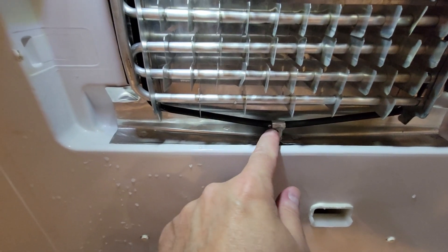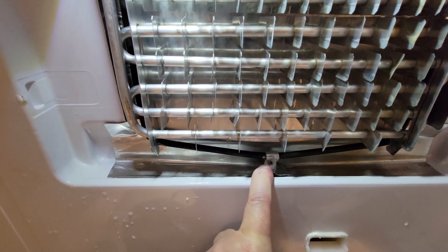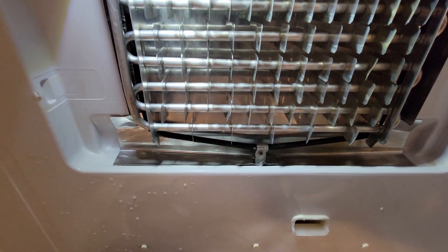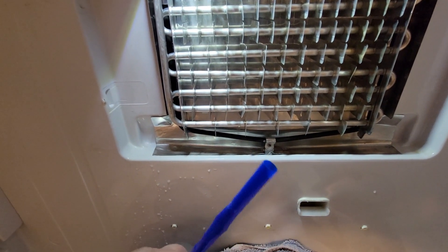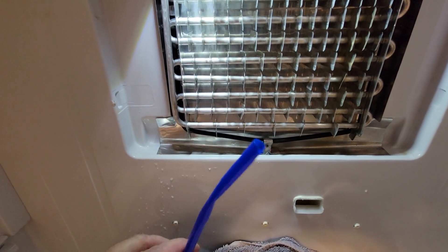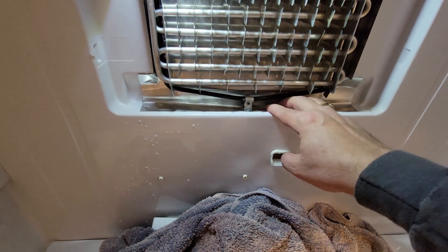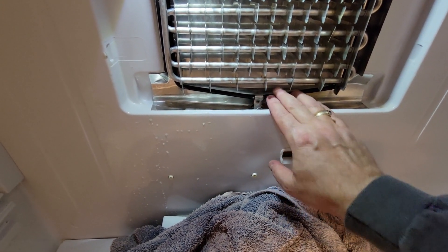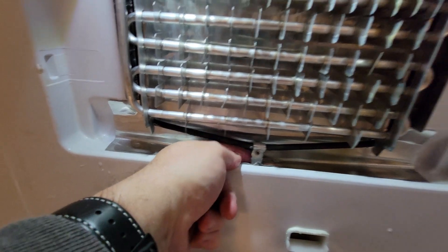Now we just have to get the new clip. We'll have to cut this off with tin snips and get the new clip, and that's going to take a day or two. So I'm probably going to have to put the fridge back together so at least we can keep our food cold and go from there. But yay, it's open! So the straw method — I don't think you've ever seen that probably online anywhere. But hey, it quickened up the defrost cycle for me. I didn't have to wait all night and I thawed it out quicker that way. I was holding the hair dryer down on there but it wasn't doing anything. Then this kept feeling very, very cold — like ice cold. I'd pour hot water in there and it would just turn really cold very quickly. Wow, that's really hot to the element because I've been heating it up with the hair dryer blowing over the straw. But yeah, this piece is just so tiny — it just barely sits into the hole. It needs to be longer.